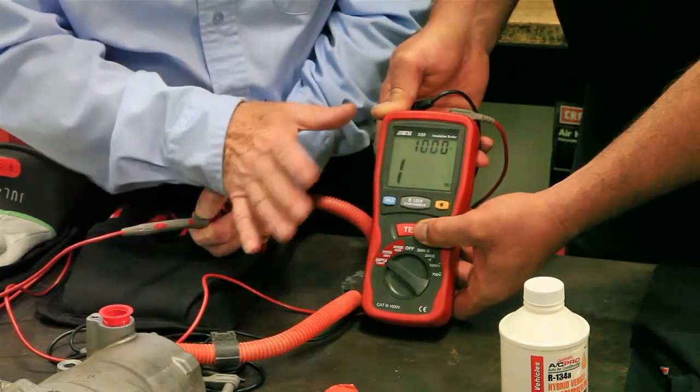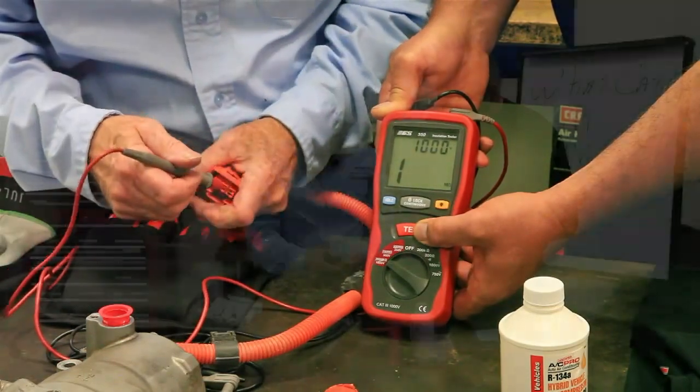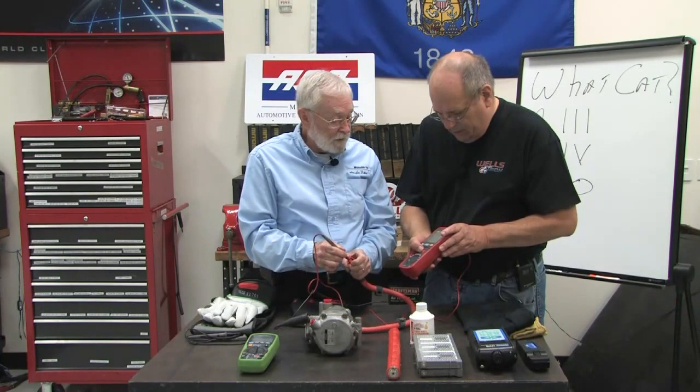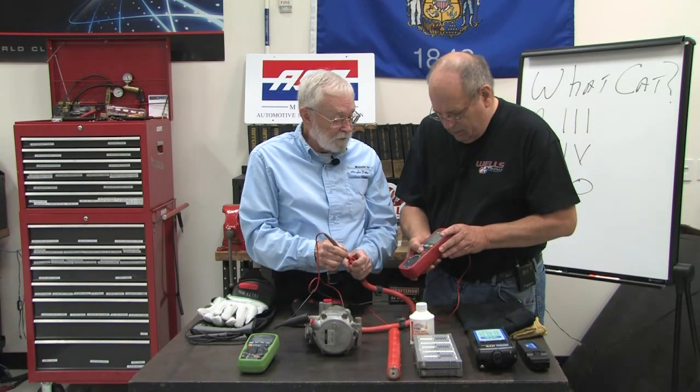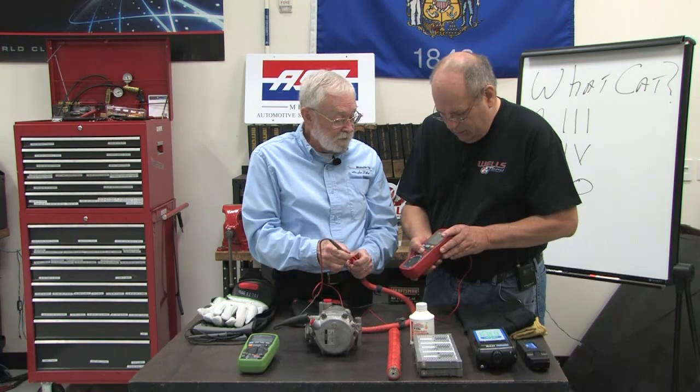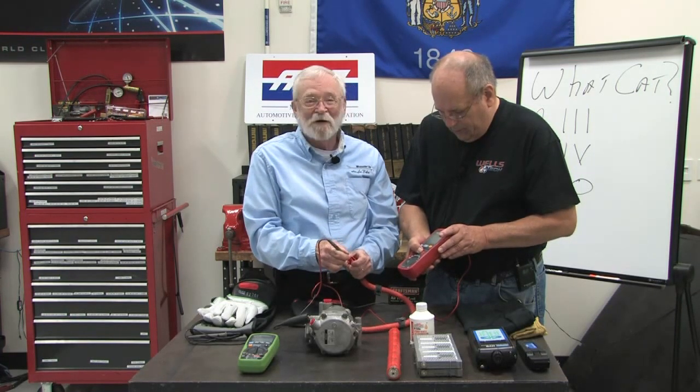Right, but this is infinity. So we see there's no leakage on that cable. And I'll do the next one for you. Go ahead. You're at 999 volts. So we're good there, 1,000. Good there. And good there too. Okay, excellent.